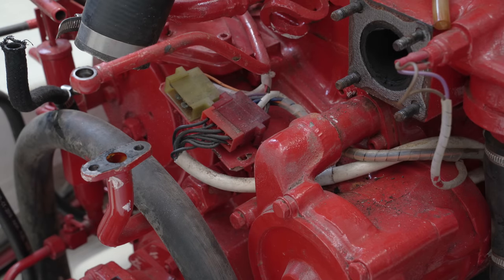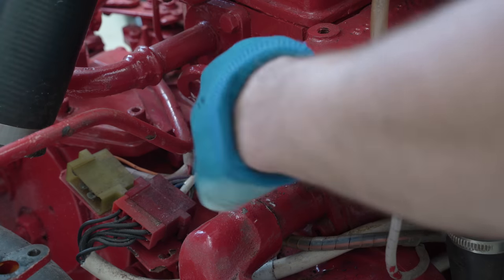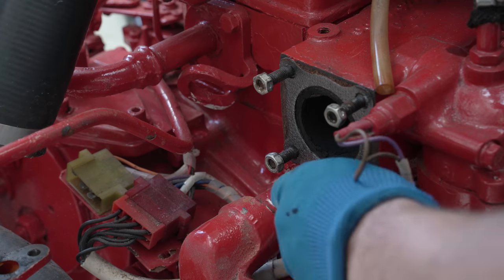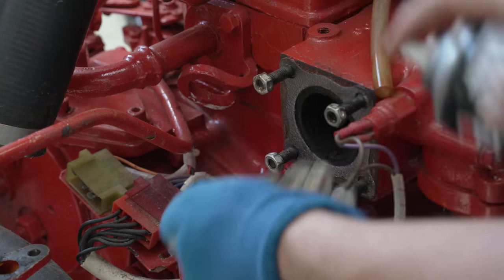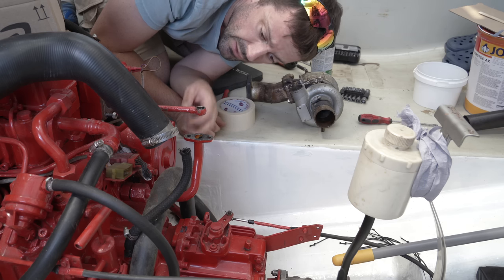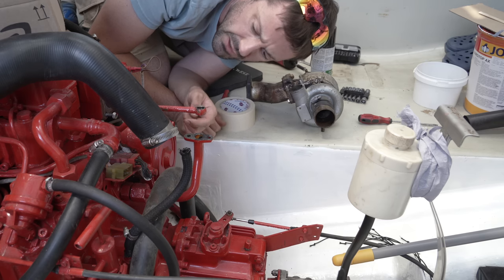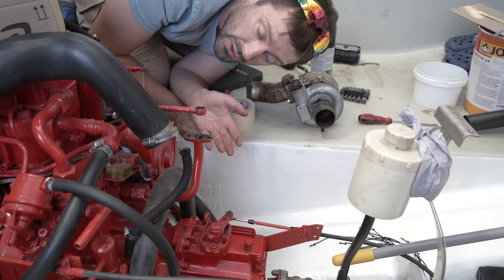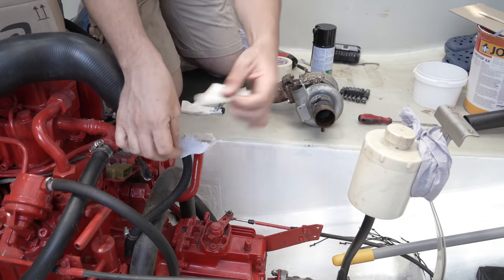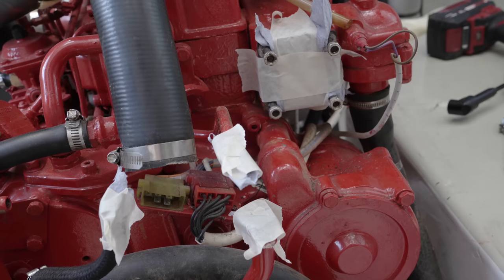Two things before leaving the engine for a week or two. I'm interested to see if I can save those four studs sticking out of the engine block — the threads look okay except for the ends. So I've oiled them, plus squirted on some more rust dissolver into a nut and plonked them on the dodgy bits of the studs. If over time this allows them to take nuts easily, great. If it doesn't, never mind, I'll replace them. Also, all those new open entrances to the engine need attention. I'll put little seals over the ends of all these points of entry to the engine, because I don't want any creepy crawlies, spiders or anything, crawling inside. Since it'll be like this for a few weeks, that's probably a good idea. I'm not convinced this will win any prizes for elegance, but some blue rag and masking tape will do swimmingly. Any non-compliant residue from the tape can be easily cleaned off later with isopropyl alcohol. My hope is that nothing and no one can now climb inside.